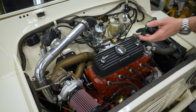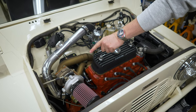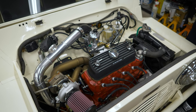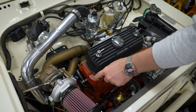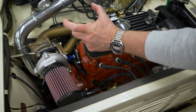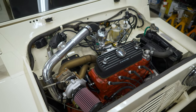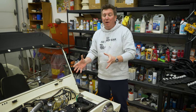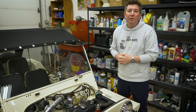We've got the GT15 turbo with the K&N air filter. We ran the oil drain off of the bottom of the turbo over to the back of the block where the mechanical fuel pump would be. Because on this three-synchro, four-speed, 850 Moke gearbox, there is no flywheel housing breather. So we had to do a few more custom little things because this is a mini Moke — a turbocharged mini Moke. We kind of nicknamed it the Toke. Turbo Moke. Toke.